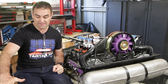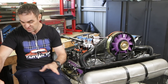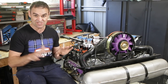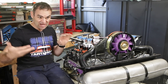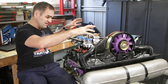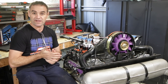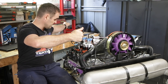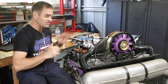I have a lift table here — that's what I actually used to get the engine out of the car. It's a fantastic piece of gear; I'll put a link to something similar in the description. It's a 500 kilo lift table and I can raise and lower it to position the engine. The only issue is it doesn't fit under the engine stand, so I have to lift this up with the engine crane, attach it, lift the engine up, slide the stand out, slide the lift table under, and hopefully it'll go smoothly.